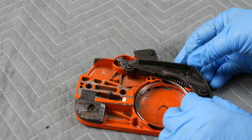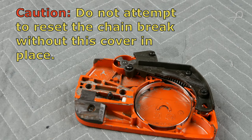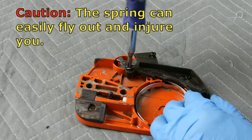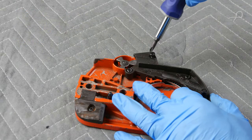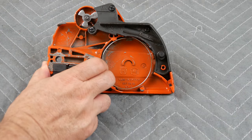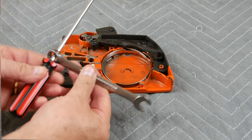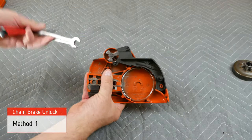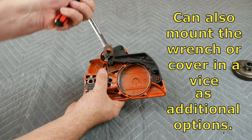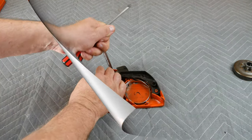Now that you've seen the mechanics up close, we'll carefully replace the cover, purposefully leaving off the black rubber heel for the moment. Now there are a couple of ways to reset the chain brake. Method one uses a wrench and screwdriver. You take the arms of the open-ended wrench and place them between two of the gaps in the three-armed metal insert. I made the mistake of starting out with a non-padded screwdriver — this procedure requires a bit of force, so you'll see me switch out the screwdriver for one with a bit more comfort.